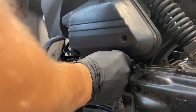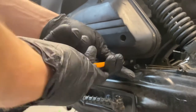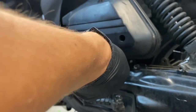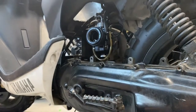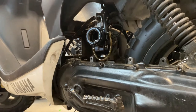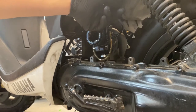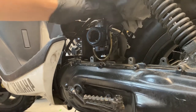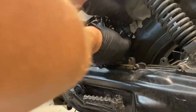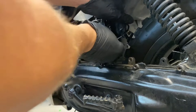I'm going to have a look at this pilot jet and make sure it's nice and clean. I'm going to take off the air box. I'll have to disconnect everything. The problem with these bikes is there's no fuel shutoff and no shutoff for the two-stroke, so as soon as I pull this two-stroke line it'll start seeping out. I'll do the two-stroke first and put something in there to plug it - I'm using a drill bit, I just don't want two-stroke all over the floor.